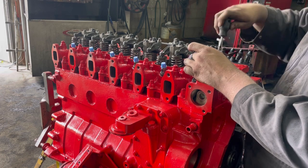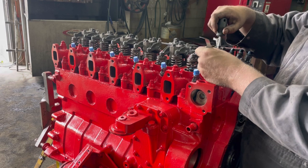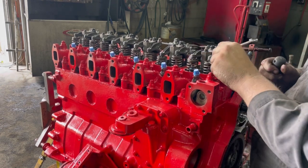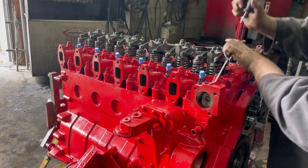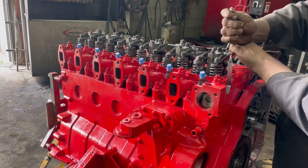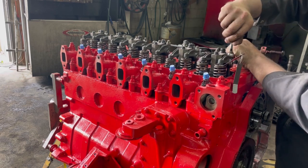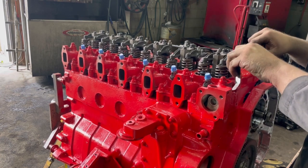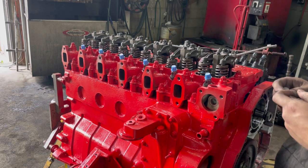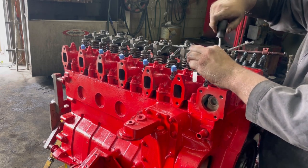As far as drag goes, there is some feel to it — that's too tight in my opinion. You should feel drag, but if the engine is oily you'll have less drag. You don't want an astronomical amount of drag. That was doing 10 thou on the intake; now we're doing 20 thou on the exhaust — same idea, rinse and repeat.